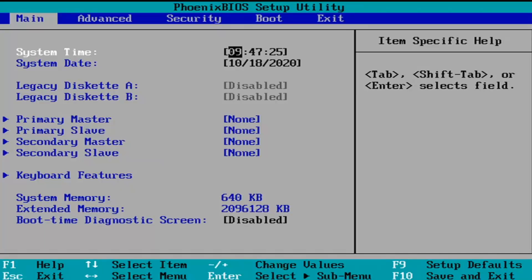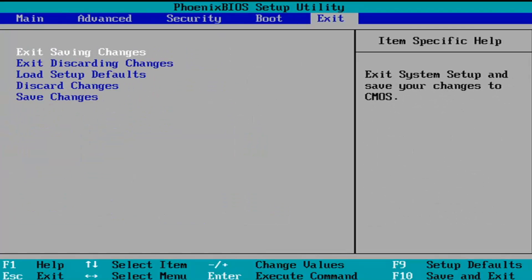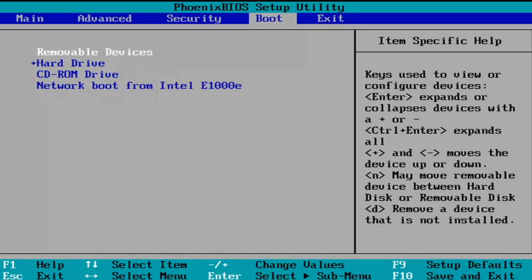You're going to hit Enter once you have that highlighted, and you're going to use the arrow keys once more to navigate. We're going to scroll over to the right, and you may have to see an option that says Setup Defaults or something like that on the top. You can see down in our System Key at the very bottom that F9 loads the Setup Defaults, and that's what we're going to select for this tutorial — so we're just going to tap the F9 key.